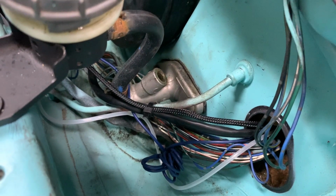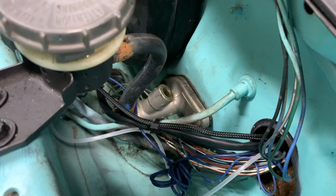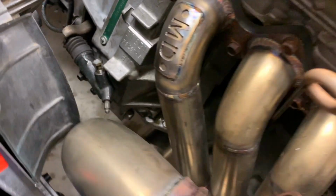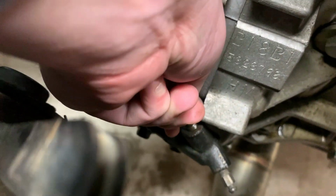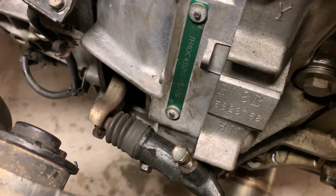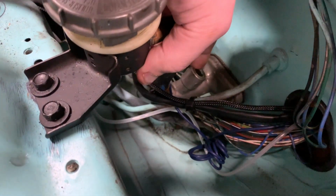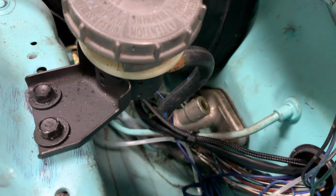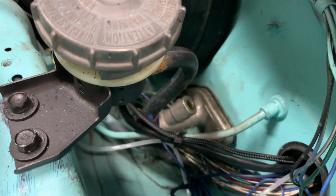So over on the actual master cylinder side, I pulled the banjo bolt down, and knowing that the slave cylinder was a metric M10 by 1.0 thread pitch, I checked that same banjo bolt that I pulled out of the master cylinder to determine that it threads in, and it's the same thread. So what that told me, with some of these cars, 92 to 2000 Civics and Integras, it may only be Civic related, but what that told me was that the master cylinder that I have on the car has an M10 thread here. So Rywire has both options. Chase Bays only has the M10 option.